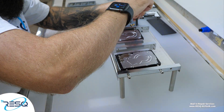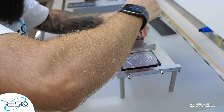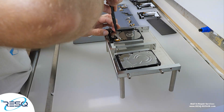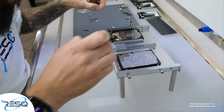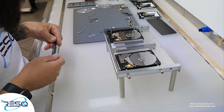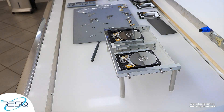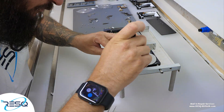Now we start by swapping the head. On the left side we have our donor drive; you can see the Apex head ramp tool. On the left side you see the donor drive — we need to disassemble it and prepare it. We take out the magnet, and on the right side you see our bad drive with the bad head. We take out the magnet and prepare for taking out the head — first the endpoint, then we go in with the tube.